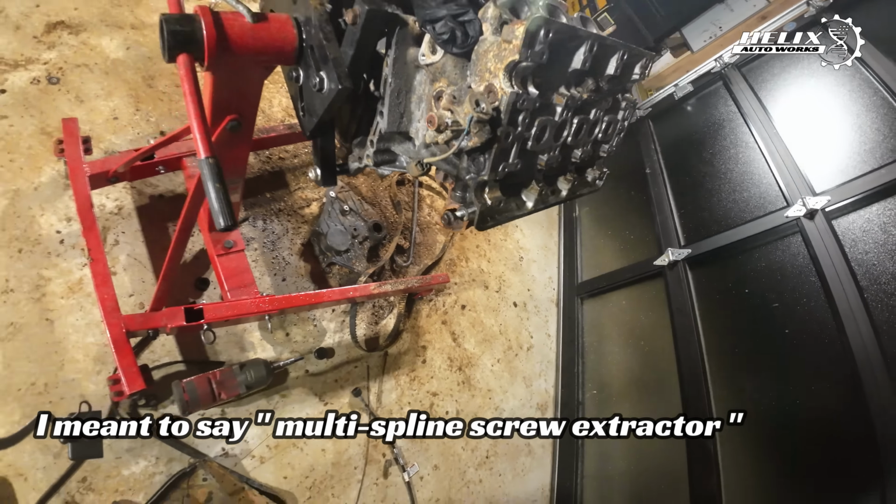I'm gonna try to take the water pump off, the cam sensor, and then I wanna get the rocker assemblies out with the shafts and the lost motion assemblies. We'll probably pull the VTEC solenoids, the oil pressure sending unit, the oil pan. I don't know, the oil pan looks a little ugly. So those bolts aren't gonna be fun. No. That's what we're doing. And we'll do that on both heads.